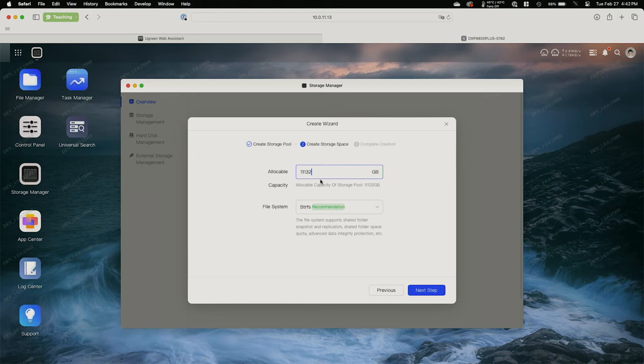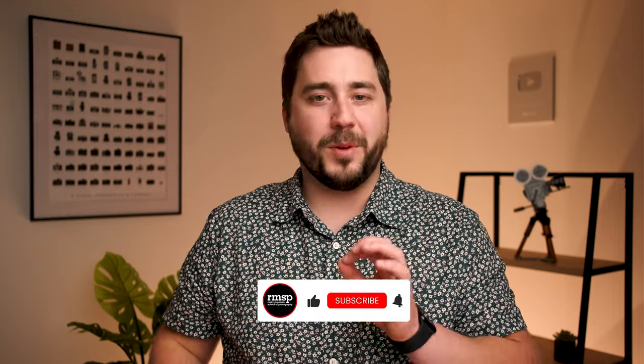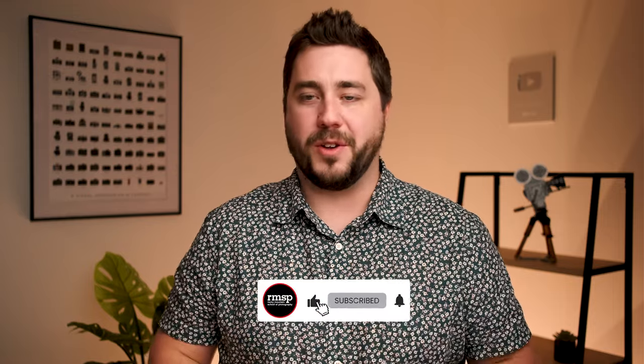I just wanna say though, before we even get to that, big important warning. This will delete all data on your hard drives. So if you have some old hard drives that you maybe have kicking around from a few years ago, do not put them into the NAS and run through this storage space creator wizard thinking that you're gonna be able to keep the data that's on those drives. It will erase it. And it's gonna tell us that in a second, but I wanna double check that you guys all know that.